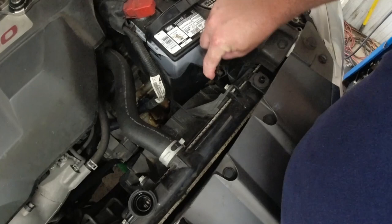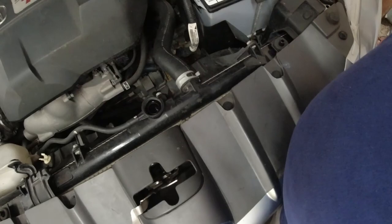I don't think I'm going to have any problems with the battery tray. Get the upper radiator hose off, get the fans out — should be able to slide them right up. Shouldn't be too big of a deal on these. And if you have a Honda CR-V, I would imagine it's very similar to this car. They're built on the same platform. The only difference that I know of is this is a turbo version of that CR-V — a little fancier, a lot faster. These things are pretty peppy. This car is really fun to drive. I think this thing's got 240 horsepower or something like that, which is pretty peppy for a little car. Let me get going here and get this petcock drain.